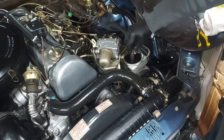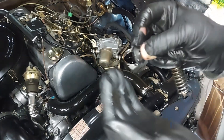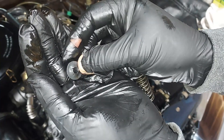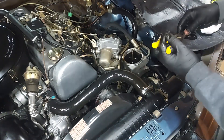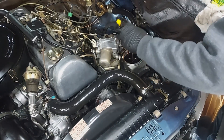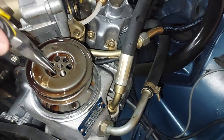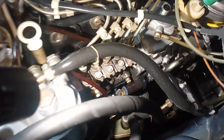The power steering fluid filter — you pull out the spring and these washers. They look like that, and you can press them down the shaft and they'll turn sideways and won't come back off when under tension. Later models — 83, 84, 85 — they changed those to 10mm nuts. We've drained out all the old power steering fluid and will replace the power steering filter. There's the original filter, and there's also the old pre-filter — it's a little dirty with some particles in it, so we're putting a new pre-filter on.